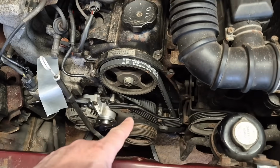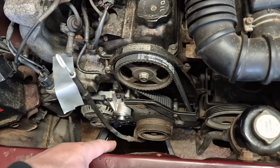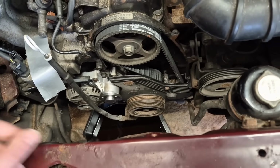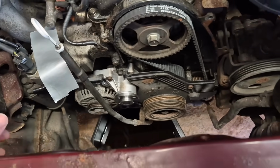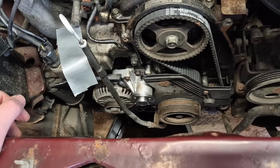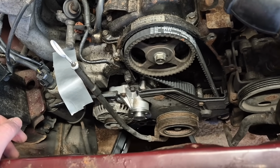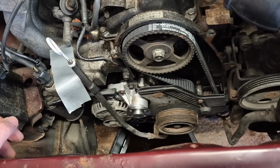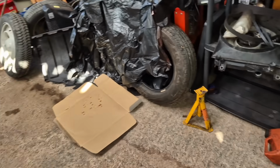So it looks like we've got to finish putting the timing belt cover on. The bottom half can't be done before you've got the crank pulley on, so we're all good there. And then we've got to try and lock the water pump pulley while we fit the actual pulley to it. And then yeah, I'm just looking at the belt run. Are there two separate belts? I hope there are two separate belts, because I think the belt I've got is not very long.